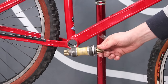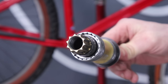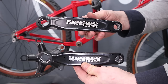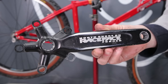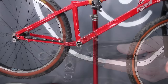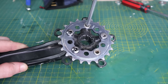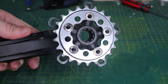Let's move swiftly onto the bottom bracket — the FSA ISIS bracket. Boy that name aged badly. I don't think it's titanium despite the gold coating but we can pretend it is. Joining ISIS are these Race Face cranks. These were often the crank of choice due to their decent strength — it was usually a choice between these and Middleburns. We are keeping it British with the chainring though, with another Pace product. The teeth are offset and there's two sets of mounting holes designed to be used on opposing sides, giving you a little bit of adjustment of the chainline. Pace seem really good at adding clever little things like this in their products.